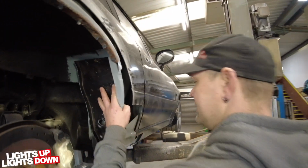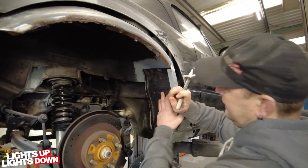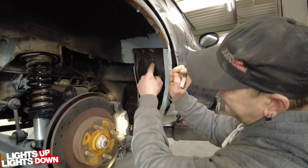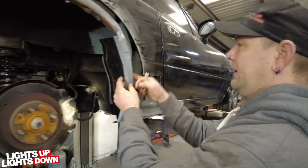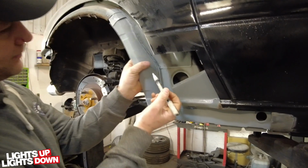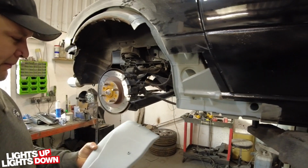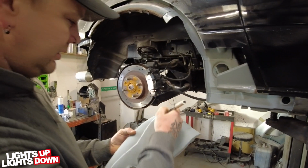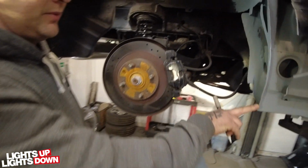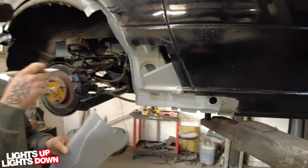So now the CLM plate will go in there like that. So we'll spot weld this in. It gets spot welded down here, which is what I was just doing, drawing a line for there. So that's a new piece in there as well, isn't it? This is a new piece in here, yeah, just finish this off. So what we'll do is then we'll draw, we've got one that goes straight up, which is this up right here. And obviously I'll trace the other side of this. Yeah. And then we'll punch holes through it to plug weld that in.